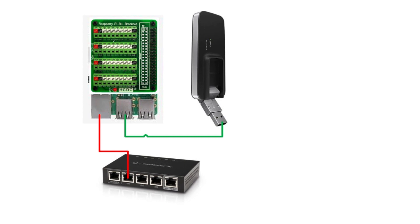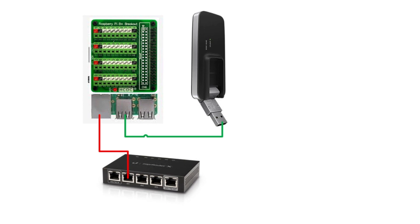We need to get power to the Edge Router X, so we're going to use a cheap passive PoE injector. Basically, it takes whatever voltage you pump into it and spits it out on the right pairs on the network. We've found that 12 volts is sufficient — most of the UniFi gear says it wants 24 volts, but it all operates just fine on 12 volts. It draws a little more current, but we're well within specs, and it means we don't have to step the voltage up from 12 to 24.